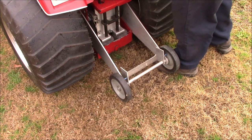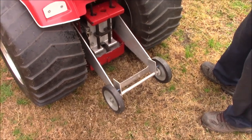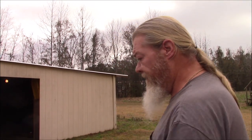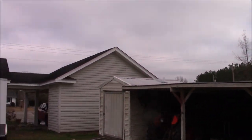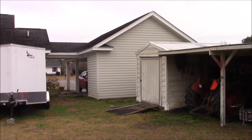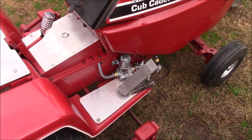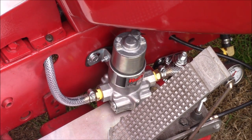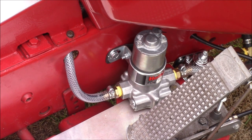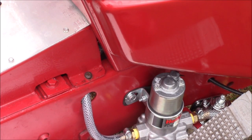These are just like the Lucas Oil Pro Pulling Series you see on YouTube and television, except they're the national quarter scale — just a smaller version. The big Holley fuel setup is over $500, the same setup used in race cars. Lee runs pressure gauges and uses 3/8-inch fuel line, which is very big. These tractors drink lots of fuel. Some setups have a recirculation line where excess fuel goes back into the tank instead of blowing out the front.